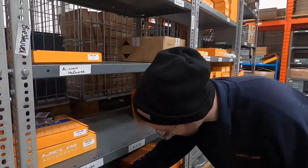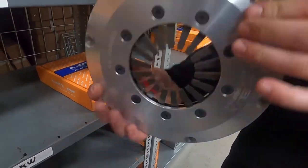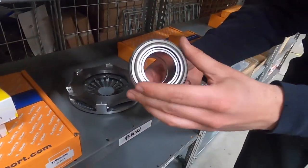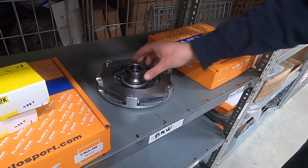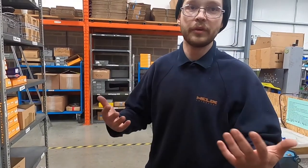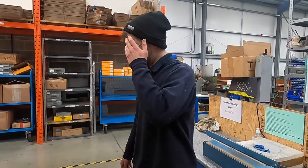There's a BMW race clutch here - E46 BMW - with the bearing to go with it. Race cars need a curved face bearing instead of a flat face bearing. Road cars have a curved spring, but when you convert to a race cover you need a curved bearing instead of a curved spring, so there's a lot of specific knowledge involved.